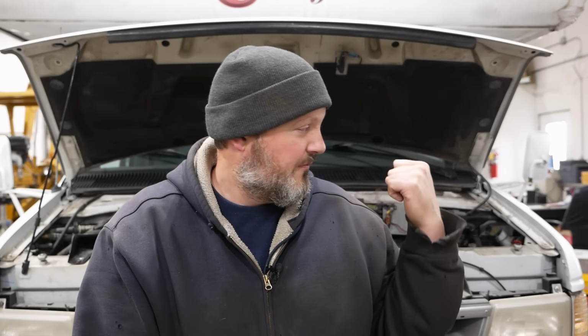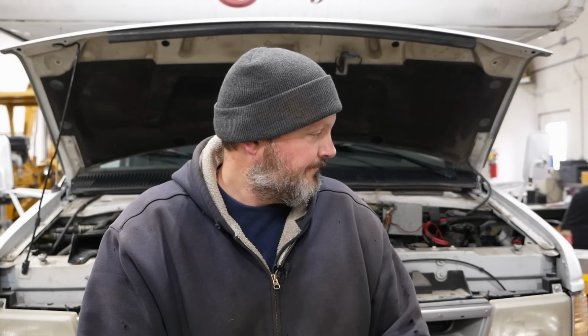I don't understand that VREF, why it was at 6.63 volts, what the VREF even means. We measured it at 5 volts at the MAP sensor, and that was before I even messed with the computer. So obviously the capacitor didn't have anything to do with that. I still don't really understand that timing advance to correct the idle. That seems like a really weird thing to do. But yeah, I guess we're gonna move on.